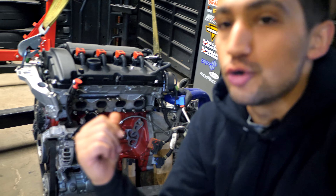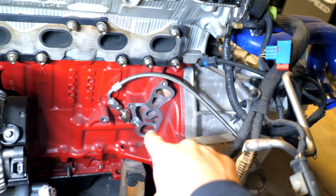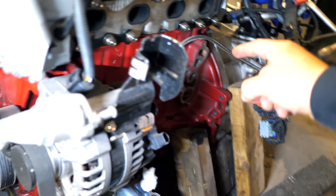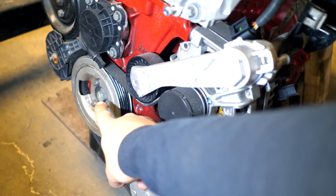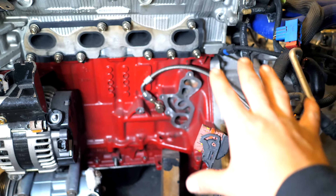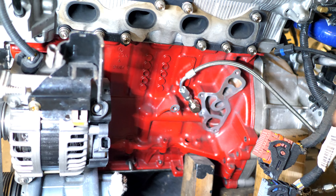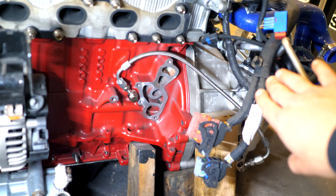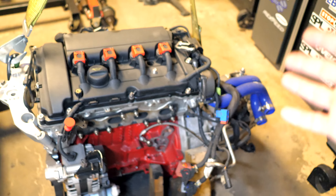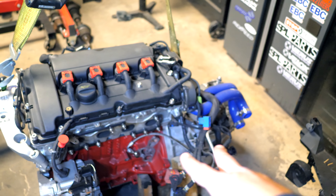The second reason why the engine had to come out was because of an engine problem. This is my Mini Cooper N14 engine. I have the engine and the transmission assembled. What I had to do was split the transmission from the engine because the rear main seal found between the crankshaft and the transmission was leaking. When I sent this engine out to my machine shop, he installed the front main seal and the rear main seal. That was a bad call because when I got it back and assembled everything, I found a leak. So I took the front and rear main seals out, installed new ones, had to take the transmission off, and put it all back together. It's a huge job just because of a $10 part — the engine and transmission have to be separated in order to change it.